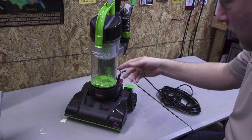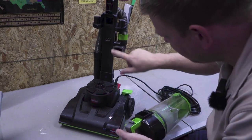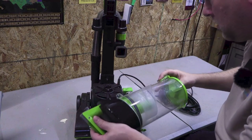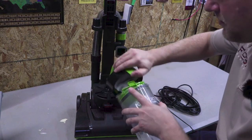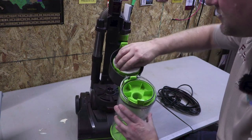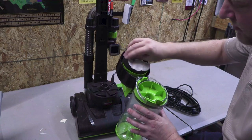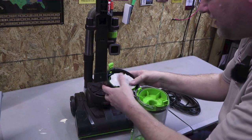The reservoir is on there — there's no bags, it's a bagless system, kind of cool. It detaches and looks like we have a pretty good seal on this guy. I'll probably have to clean it up just to be sure. The handle seal looks good. Latches are functioning. There is another filter up and under here — so we've got a pre-filter and a secondary filter. You can tell somebody hasn't really been taking care of these. Wow, it's barely used, guys — barely used. That is a win. However, this filter was put in wrong; they had it offset the wrong way. It should sit like this, pinched on this seal right here.